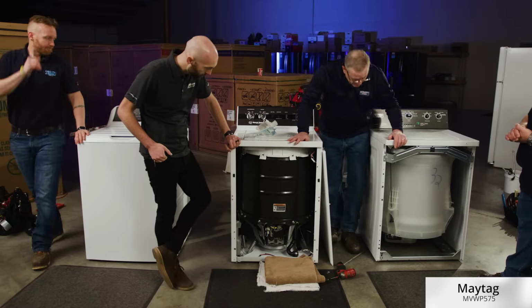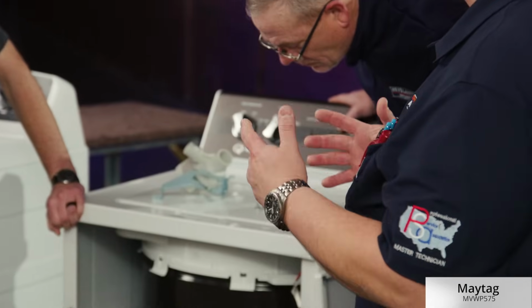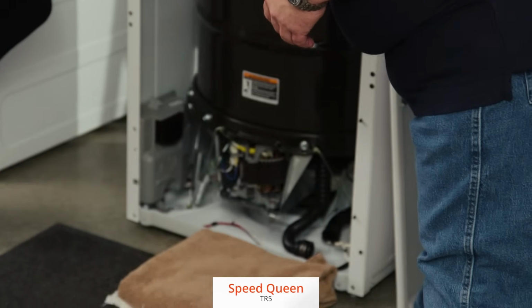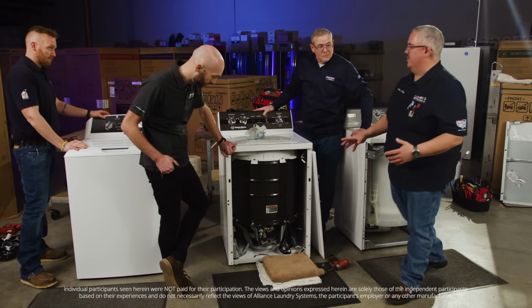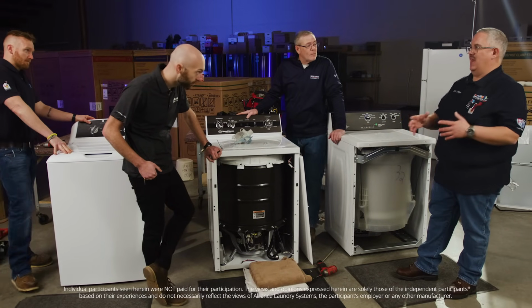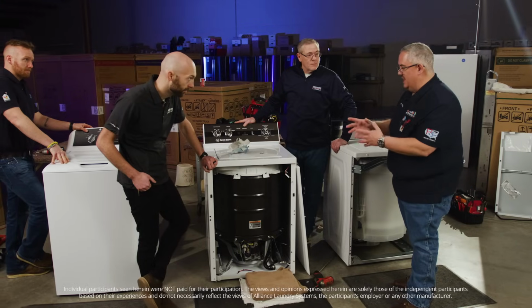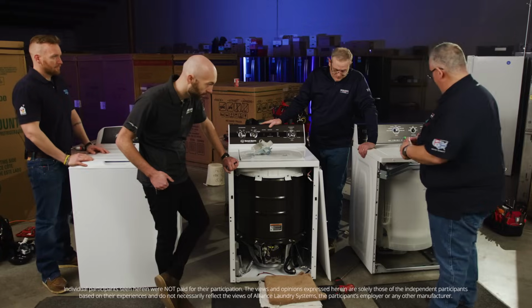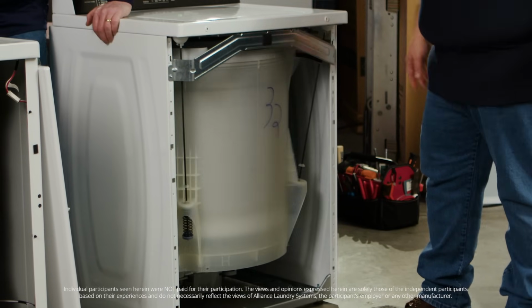Compared to these suspension rods, look at that. The actual balancing effect of this is so superior that it's absolutely night and day. I mean, I got real springs sitting on a tripod, and if anybody remembers the Maytag Dependable Care that lasted 40 and 50 years and everybody just loved it, this is still the same concept that was built back in the 70s and probably into the 60s and brought even forward today because it's tried and true, where this is a brand new design. Can you go out of balance quickly?